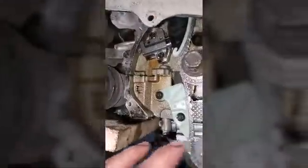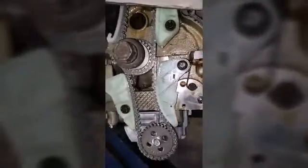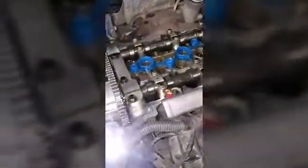Timing's all on again. Put all your guides on, make sure you're not pulling the pin on the tensioner until everything's done up. Make sure your bottom dead center mark and your bottom crank center mark lines up with the two at the top, like before. Get everything tightened and on there. Then you're going to want to spin the crank two times around and make sure your lines are coming back to where they're supposed to. Timing cover's back on, now put the valve cover back on. For the timing cover - clean everything off, no oil, no RTV left, put a thin bead on it, place all your bolts in, and torque to spec. The exact same process is for your valve cover - just do the corners with RTV, though I usually go around it with a thin bead anyway for a little extra protection.